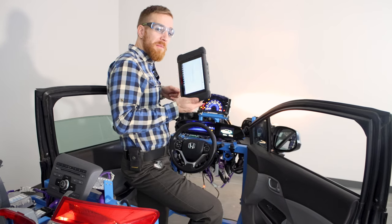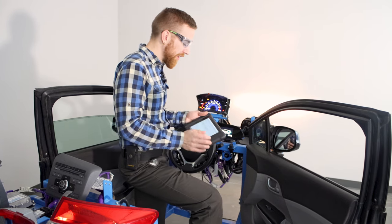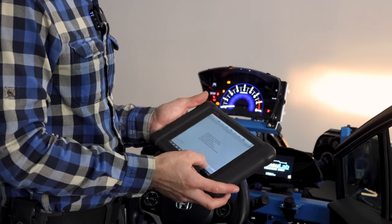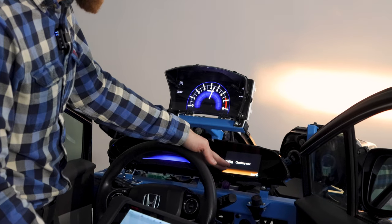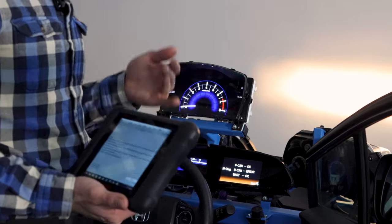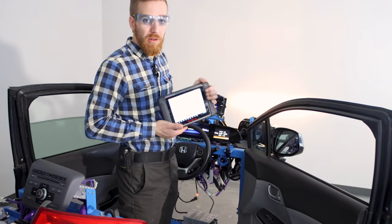One of the things your students will be doing most with the multiplex trainer is using the scan tool. One of the coolest things — and one of the reasons we chose this platform — is that it's got three different CAN buses and we can access them and do a self-test with a self-diagnostic function that engages the modules. We can see here we're doing a self-test, mdiag checking now, and we're going to see three different CAN buses. Earlier I disconnected one of the modules and you can see I've got a BCAN error. This gives your students easy hints to find out whether the issue is in the high-speed CAN, medium speed, or low speed, and from there they can get a code and follow the diagnostic procedure.